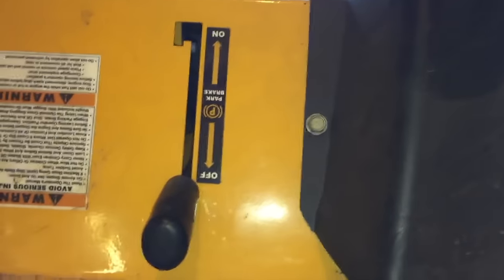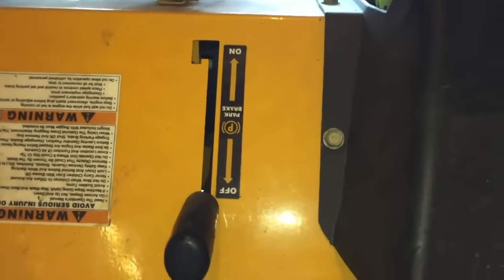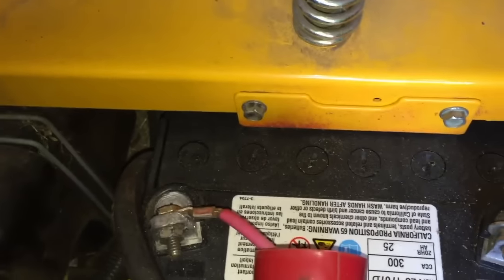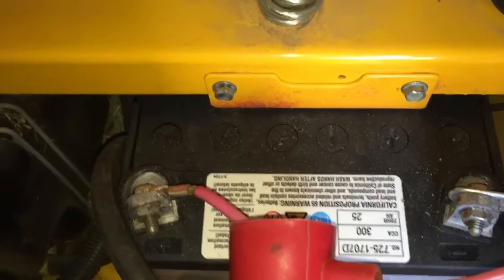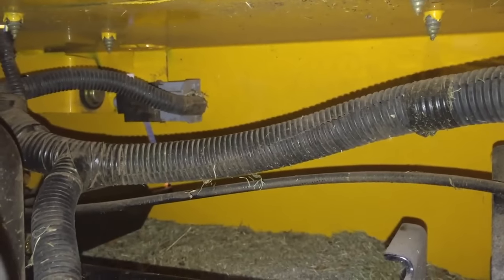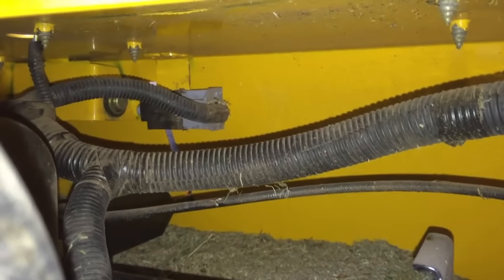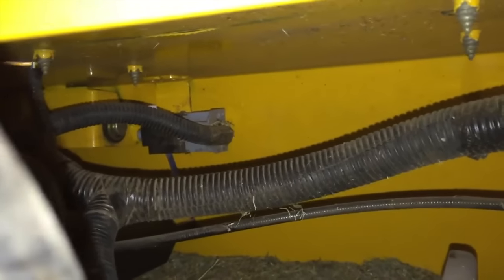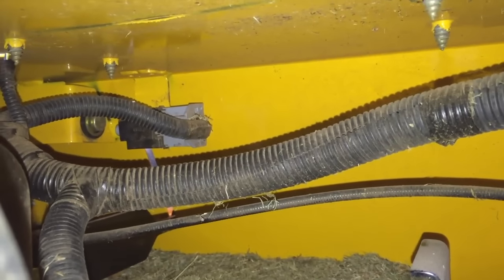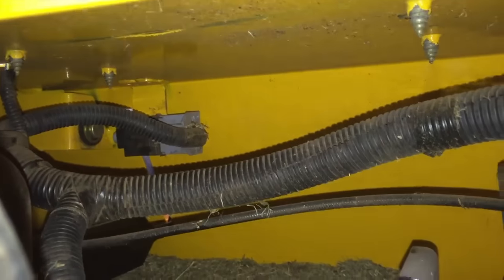The side of the body of the mower is solid so I can't go from the side. I don't want to remove the deck if at all possible, so I'm going to try to go in through the back. On that side you have the gas tank and on this side you have the battery. I think if I remove the battery I should be able to get to it from the back side to remove that switch, and then we'll look at how to test it. Once the battery is removed, you can see that top black line — which is a wire cover — going all the way to the front. With the gray piece on the right and the black piece on the left, that is your switch for your parking brake, and there are no screws, so we have to figure out how to remove it.